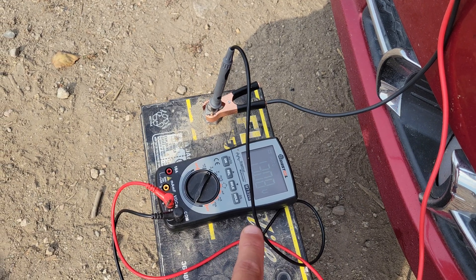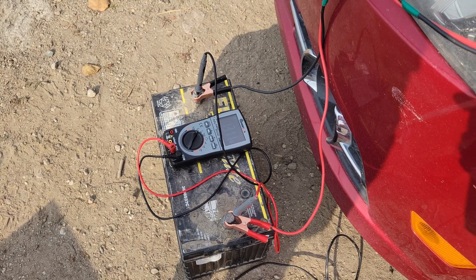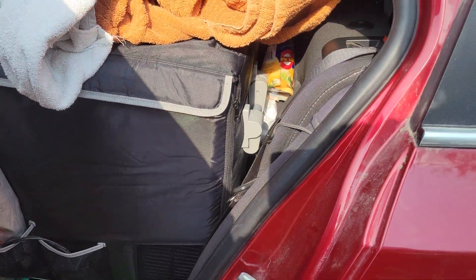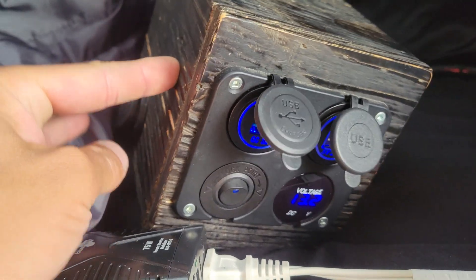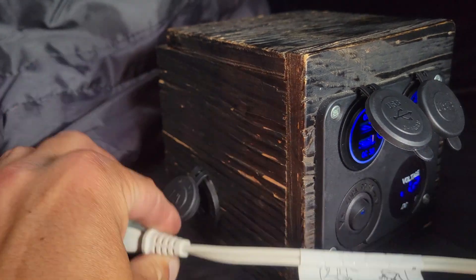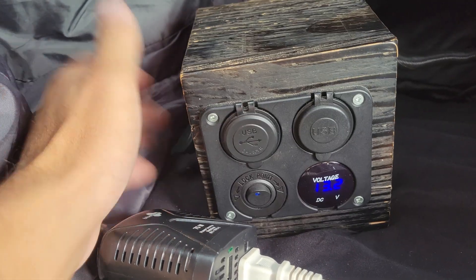From here this goes to another fuse block which is behind the subwoofer box right there. It also has a 60 amp fuse block and the stereo side has an 80 amp. There is a four gauge cable that runs through the car to the front battery which gets charged by the alternator. The battery is also fused up here with a 100 amp fuse connected to the starter battery. The house batteries are charging the boat battery here with some basic 50 amp battery clamps picked up on Amazon for like 13 bucks. Everything's plugged in, the freezer is working right there. Here is the house box — this is where I plug in my phone, USB, anything I need. The side has a 12 volt plug which I use for a mini inverter that powers my heating pad. I can move it around, hide it, put it over on the freezer when I'm going to bed.